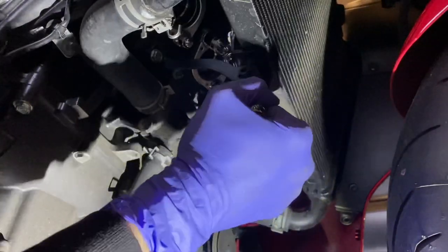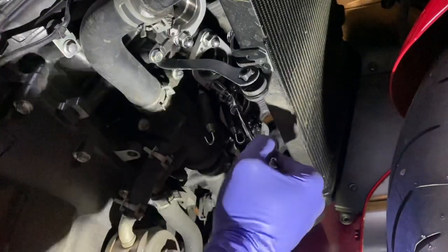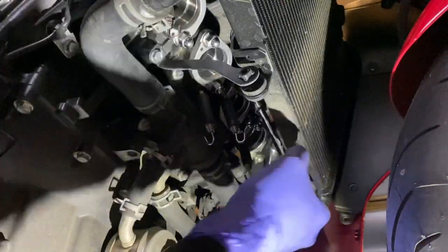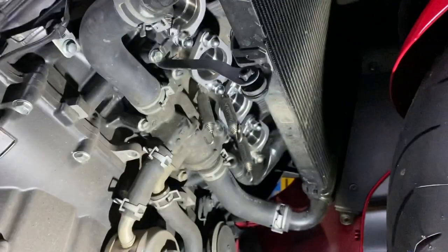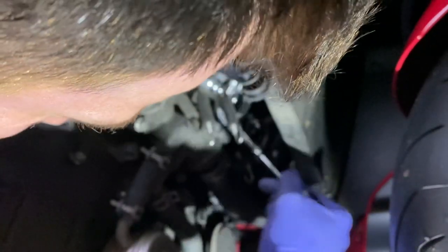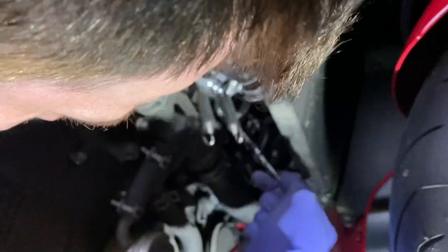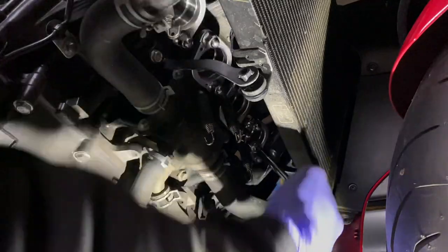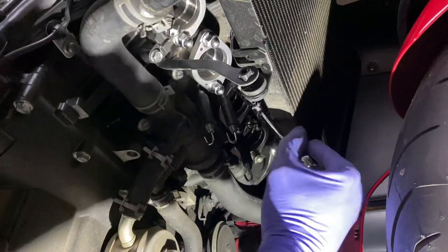It's quite strange. The other exhaust was actually held on by these bolts, whereas these bolts are just holding the sleeves in place, and the spring is actually what's holding the header. So slightly different setup. These springs are under a hell of a lot of tension, so I imagine they're there for a bit of flex, and as and when the exhaust warms up, it will expand. So let's just make sure these are well seated.